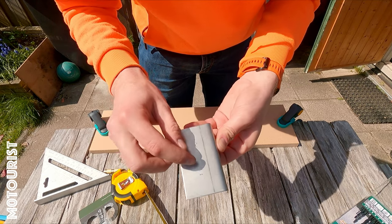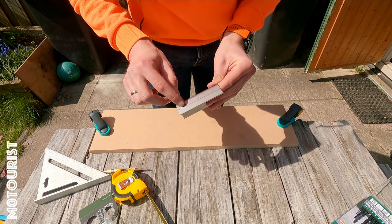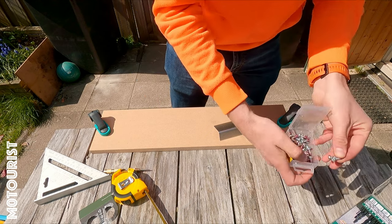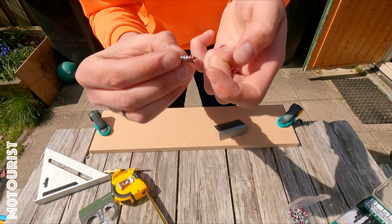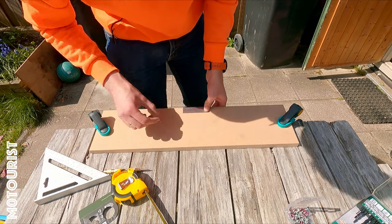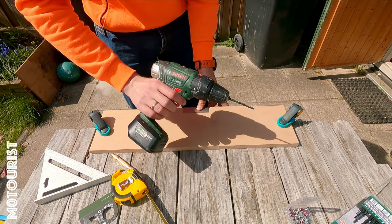All the holes are marked — I missed marking this one and this one — but I'll put center punches in. It's real 5mm holes, and for this I got some 5mm screws that are 16mm long, which should be fine. Before you start drilling into your console, you need to check if there's any wiring behind it, because it would be a bit of a shame if you do have a USB connection but the rest of your console doesn't work anymore.